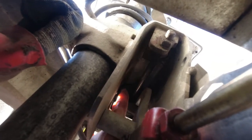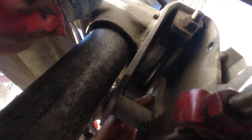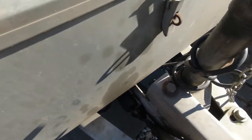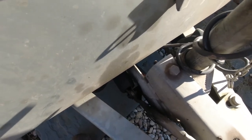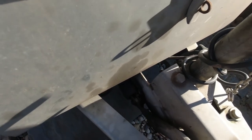With that going upside down, we've got a draw shaft up there. That's the thing there with your fingers on. The pin actuates on it - so as that gets pushed back, this gets turned, yanks on that, pulls the brakes. Apparently if you do it too tight, the brakes will start to come on, which I've just got it starting to bind. So I'm going to undo it at that back linkage just so the brakes don't bind.